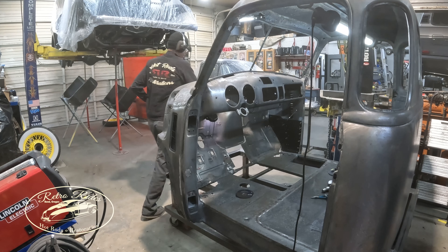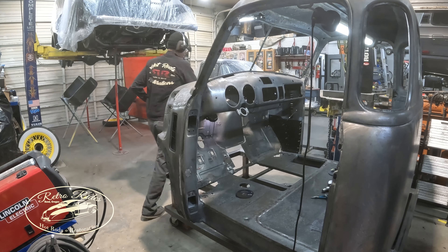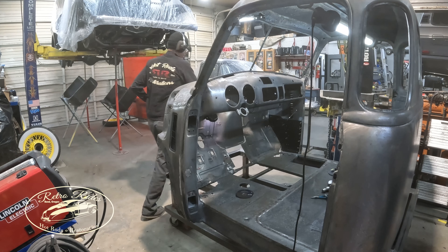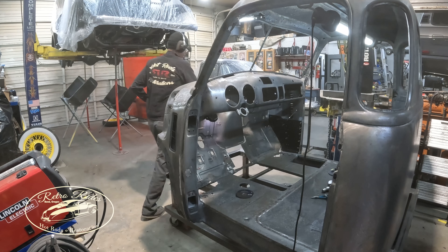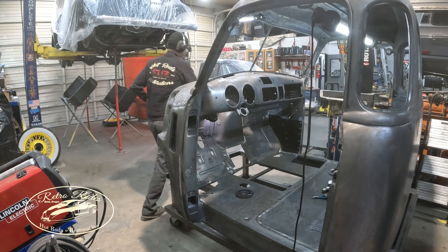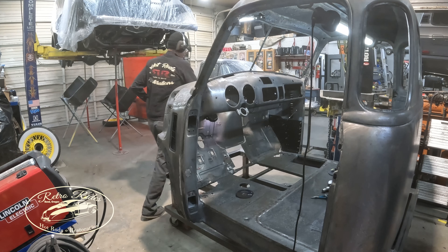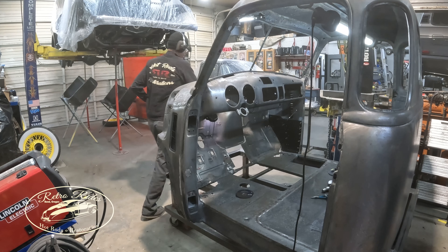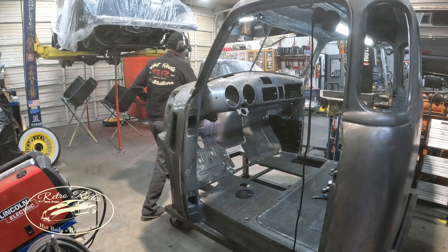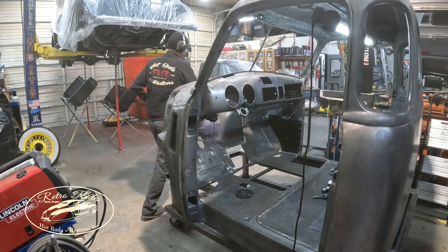So I'm getting out the old inner panels. Basically down on this weld on the bottom of the A-pillar, I've cleaned out the groove to cut the floor part out, and also the panel lip — this little lip right here — so I can put the new panel lip down in there. The new floor will also have a lip to throw down on that side of the rail, the frame rail with the body cab. So I'm getting those fit and getting ready to burn them in, and then I can move on to the floor.